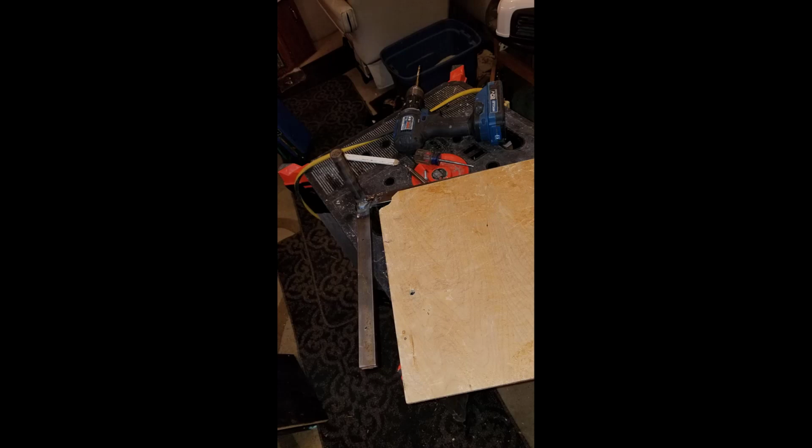But if you don't have a welder, and I don't think everybody would have, it wouldn't be difficult to make something like this using aluminum and just brackets from Home Depot. This doesn't have to be very heavy. It's only carrying a few pounds, but you do have to support it because it's only held in two dimensions. A weld will hold it solidly, but if you're going to use a bracket, you're going to have to use a triangular, three-sided bracket on it, and that would work.